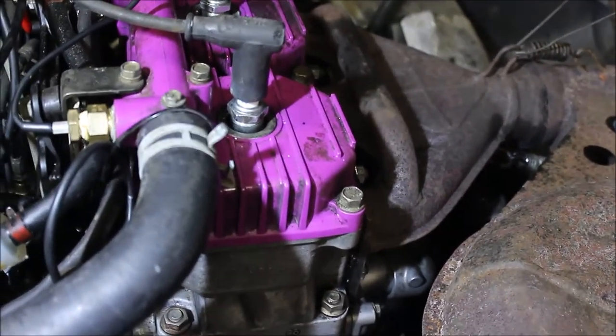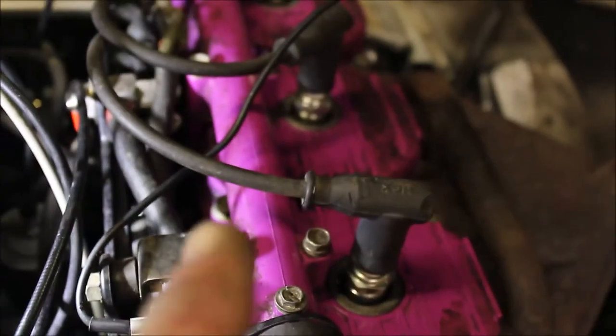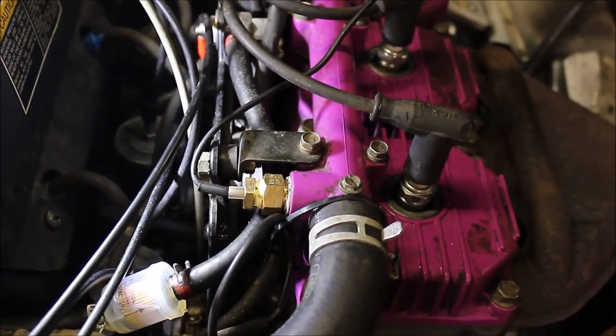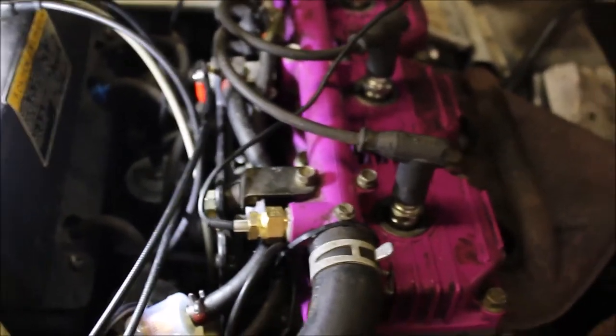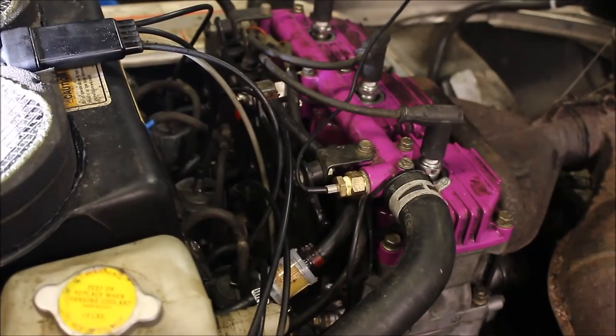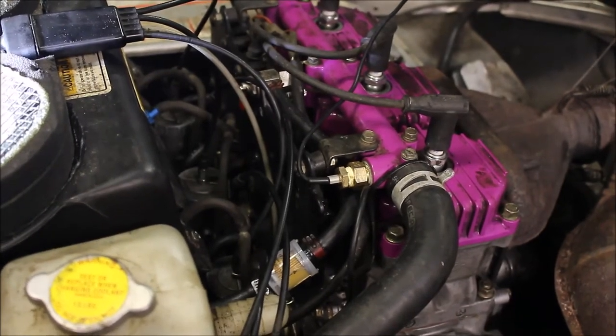One thing to keep in mind after you install your water pump: don't forget to top off the coolant and bleed the air out of the coolant lines. There's a bleeder screw right there — crack that open, there's a hole in it. Start topping off your coolant and the air will rush out as you're topping it off. The Polaris book recommends starting it and letting it circulate while it's cracked open. I just cracked her open as I was filling it up, waited to see coolant leak out of that little hole, then tightened her up and topped it off again. Took her for a test run. If you don't bleed it out, it's going to cause overheating issues because there's going to be an air pocket trapped in the hose somewhere and it won't cool properly.